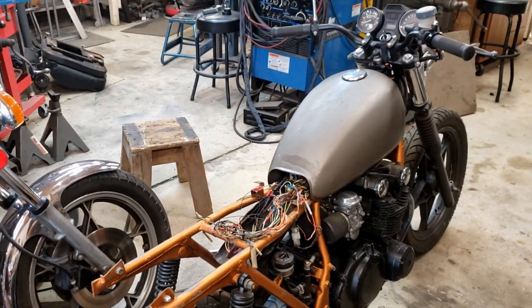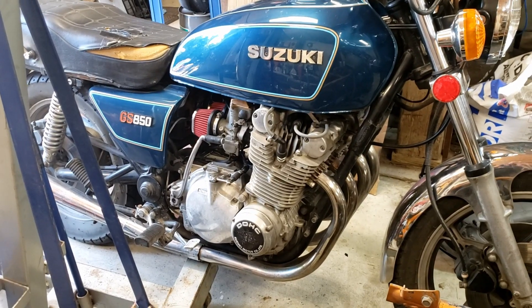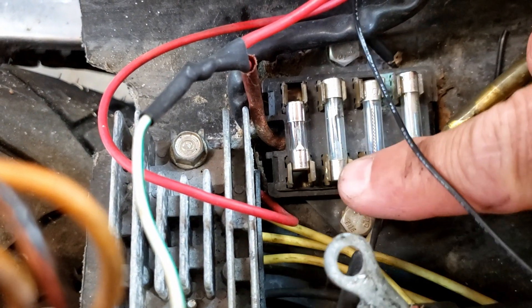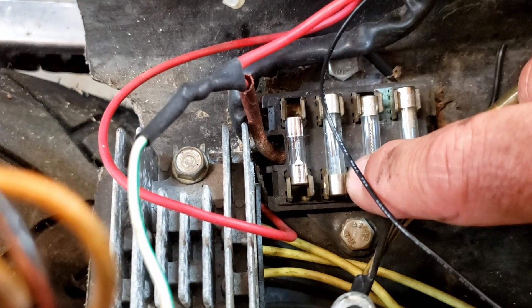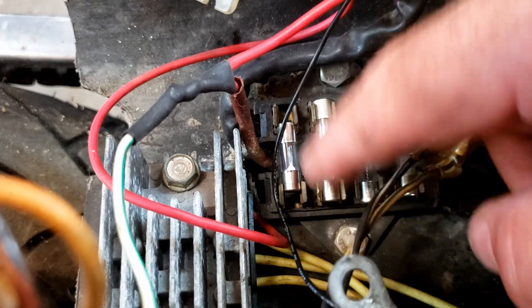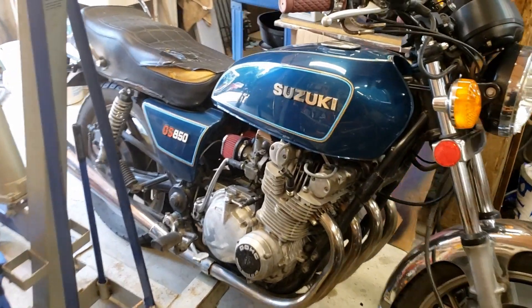There's really nothing to it — sometimes it's really dumb. This other bike I struggled with for two years, put it away, tried to sell it, got it back out. It had electronic ignition too, brand new coil pack, still couldn't get it to run. I found out I was test-lighting the terminal side of these round fuses. I test-lighted the other side of the fuse but did not test-light the little squeeze bracket. So I lost connection between the fuse and the bracket, and that was causing me problems for two years. All I did was pop the fuse out, wire-brushed it up, put some dielectric grease on it, put it back in — never had a problem since. Generally, that's all it's going to be if it's electrical: something stupid and easy. You just got to find it.